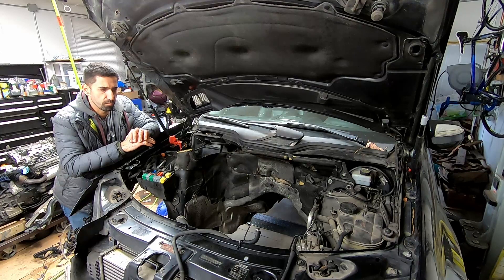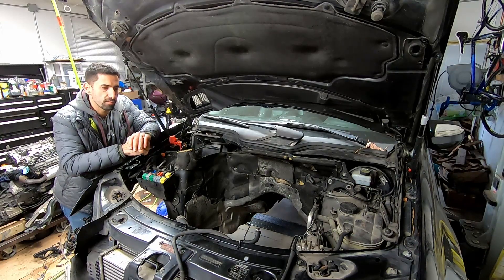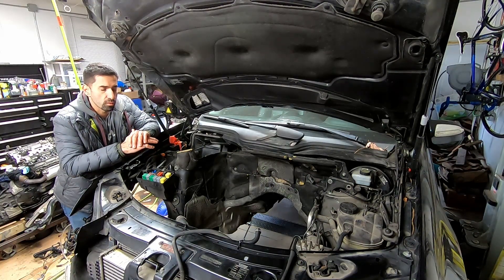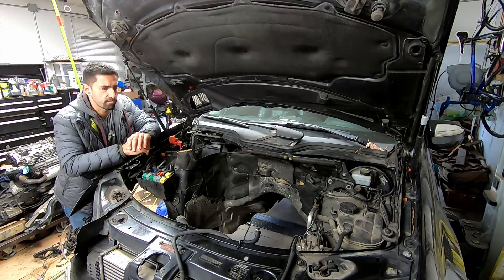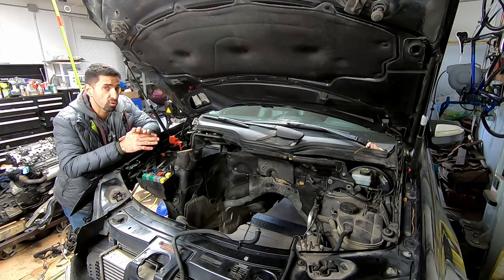The biggest problem I've got right now is an oil leak leaving oil all over my driveway and making my wife really mad. I suspect it's the oil cooler seals in the middle of the V. If you're familiar with the OM642, you'll know that the early versions of the motor are notorious for leaking oil from the oil cooler seals because the seal design or material was bad. I'm perfectly capable of replacing the seals with the motor in the vehicle, but I decided to take the easy way out and actually pull the motor and transmission.